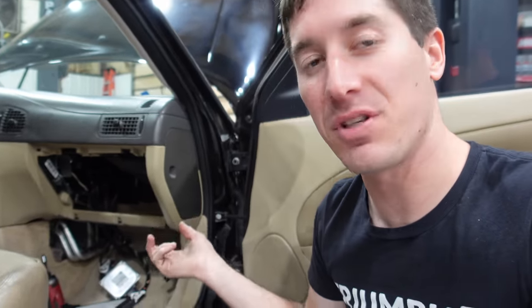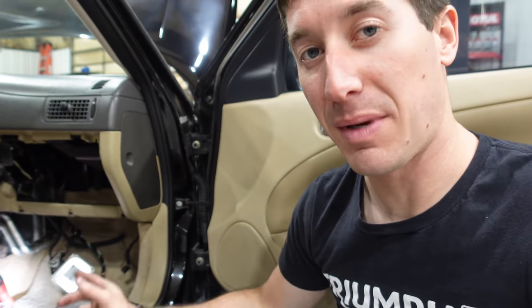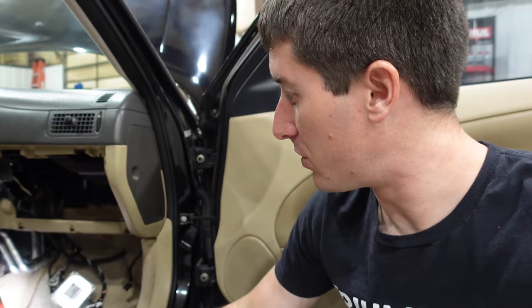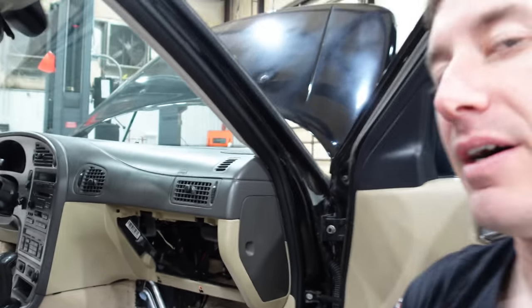Alright, I don't think there's anything else - I got the whole car vacuumed out. Time to install the new one. Up at the top of the heater core box - it's really the evaporator box - there are two hard lines for the AC. There's a foam strip that comes with the filter that goes around those lines. I reached in there blind - it's already perfectly cut for those two lines. You open it up, take out the inserts, slide it around the line, and push it up to the top until it's flat. That helps stop air from coming around the cabin air filter. In the automatic you'll have to drop that transmission computer - there are two tabs at the back, push down on the tabs, and the computer drops right out. Done. Then put the glove box back and put all the covers back on - it does take a few minutes, and I guess it's probably worth your time if you find a quarter-inch ratchet in there.